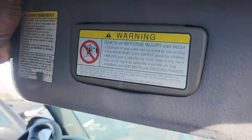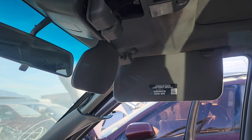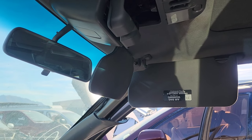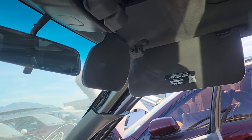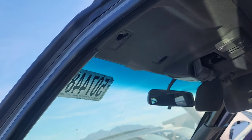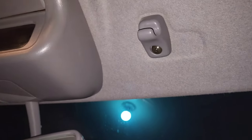I wasn't going to go ahead and get both of these, but I realized I really only need one. I'm going to show you guys what's so special about these. The cool feature is the main portion of the sun visor can be flipped towards the door, and then you still have this residual piece that you can flip down, so you're blocked on two sides from the sun. We already went ahead and harvested the driver's side. On the passenger side, you're going to need a plastic trim removal tool to remove the cover and reveal the two Phillips head screws behind that, plus one that's exposed.